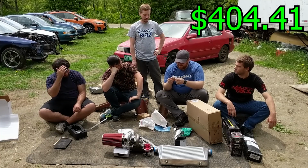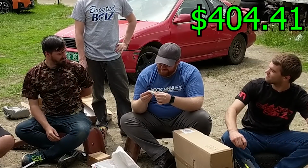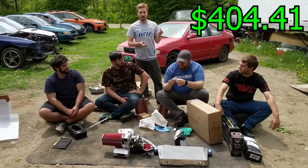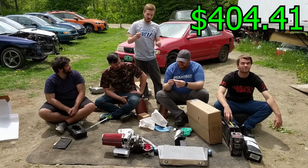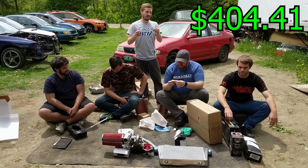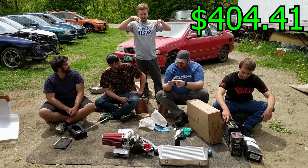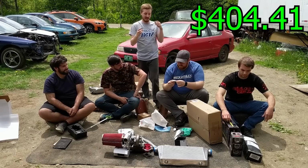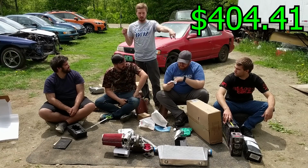Oh, just a splitter of some sort. Yeah. I don't really know. It's an oil pressure T, basically. Nissan uses British standard pipe thread for their sensors. So this is a BSPT to BSPT so that I can still use the factory oil pressure sensor, and then a T out so I can use the turbo feed and also my new oil pressure gauge.